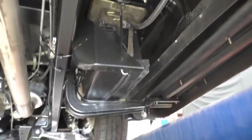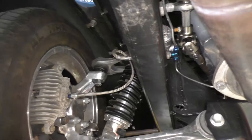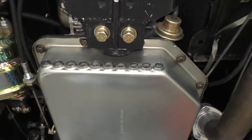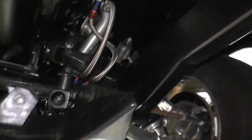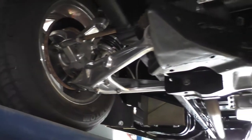New cab corner bushings in it. Braces. Batteries are there — access is in the passenger compartment. There's a Corvette style master cylinder with power brake booster. Power brakes. Up front, fully independent suspension, coilover style. Billet upper and lower control arms — looks to be Corvette style. Turbo 350 automatic transmission with a deep sump cooling pan. Power steering pump with braided lines and power rack and pinion steering.